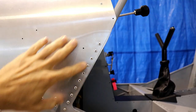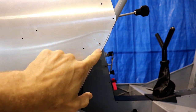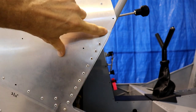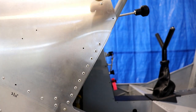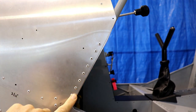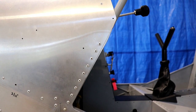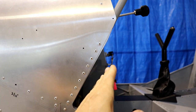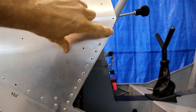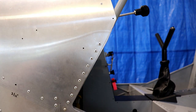One last thing I wanted to mention on this area: the instructions tell you to cut or trim this edge 10 millimeters from the rivets, which I did. But this line I drew here is the back edge of the steel cage that comes down. So this part on the very edge of this aluminum sticks out past that steel tube. I'm not sure if that will interfere later with the other parts or with the door. So just keep in mind that on mine here, I may have to wind up trimming this area a little bit more. Every airplane might vary just a little bit.